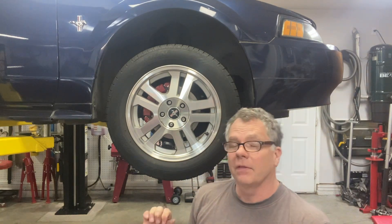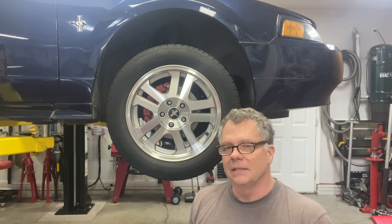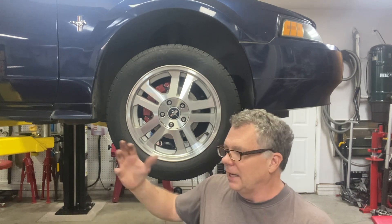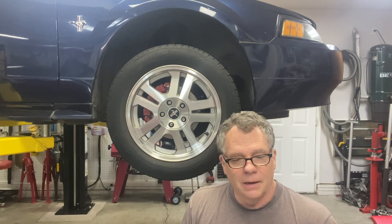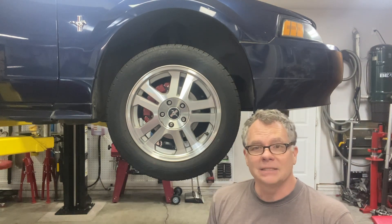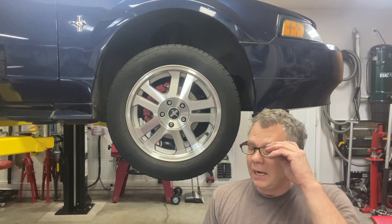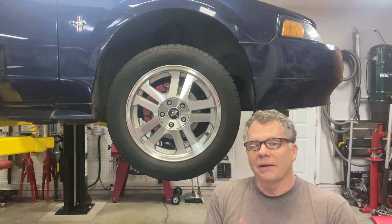All that's left is installing the coolant tank, the radiator fan, and the serpentine belt. I'm going to go ahead and run it, but we won't know whether we really have the leak fixed until the next day — it's a very slow leak. I'd have to drive it, get the engine up to full temperature so the oil thins out, park it, leave it overnight, and just barely see a little bit of oil. We may need to wait a few days or even a week. Anyway, we'll keep our eye on it and see if this was a success. I'll catch you on the next video — bye.